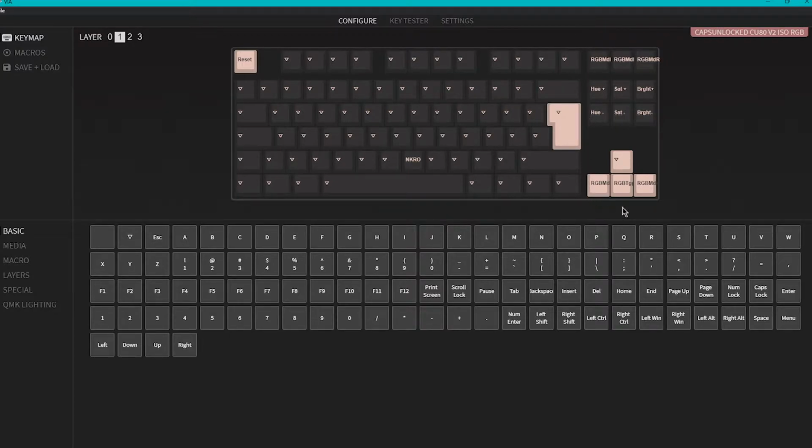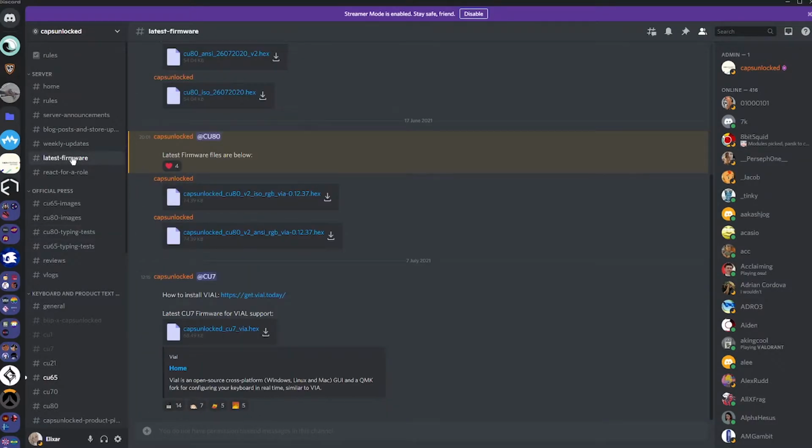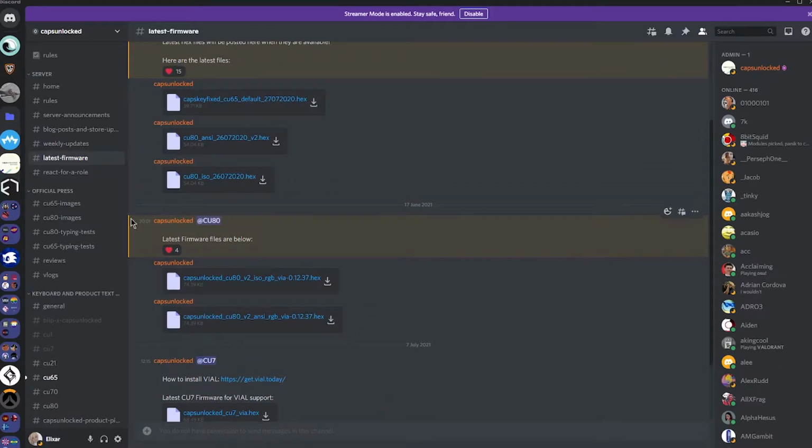However, this board does have more than competent onboard lighting control. After flashing to the newest firmware, which you can find in its dedicated channel by default, your lighting control will all be on the function key and the nav cluster. Speaking of firmware, the board is known to have a bug where after rebooting your PC or waking it from sleep, the board wouldn't respond until unplugged and replugged. So if your board out of the box is doing the same, make sure to go to the capsunlocked Discord linked in the description and check the latest firmware channel to get the latest firmware, which you can flash onto your board via QMK or through VIA.